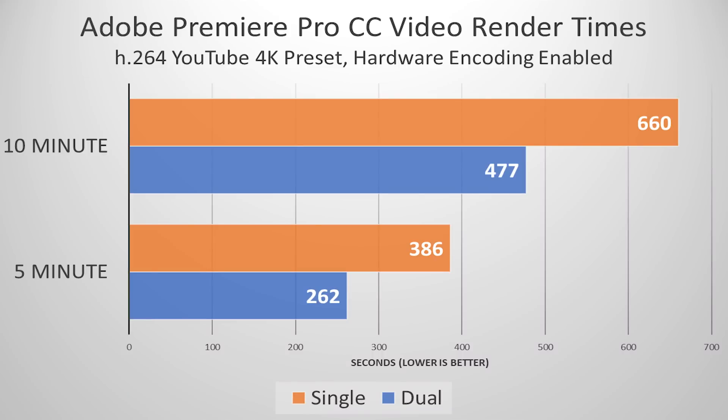The video title says gaming, and I feel like you got a good dose of that, but I want to reveal a case where a system can benefit from dual or quad-channel memory outside of gaming — and that's content creation. The application I use is Adobe Premiere. I tested a 4K and 1080p mixed 10-minute timeline and a 5-minute timeline, and the resulting bars indicate how long in seconds the render took. Dual versus single-channel memory makes an enormous difference here — a 3-minute difference for a 10-minute video render, and a 2-minute difference for a 5-minute render. We're talking around a 40% difference in render time. It would make absolutely no sense for any serious content creator to run in single channel, and this is why.